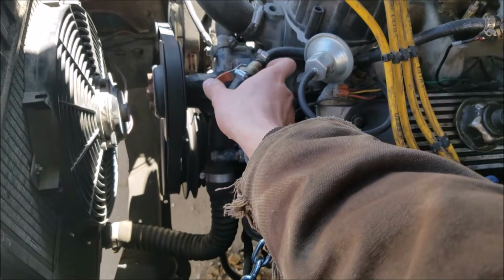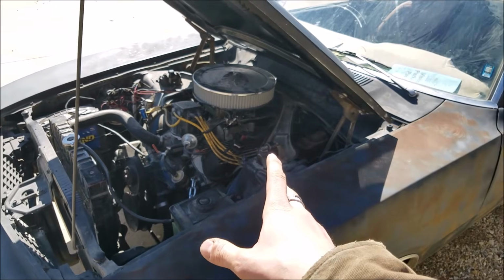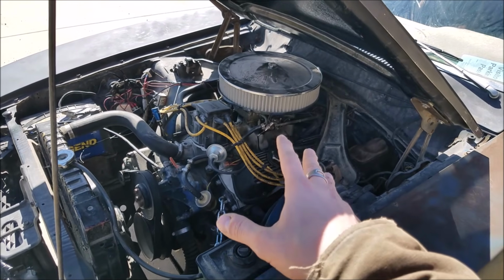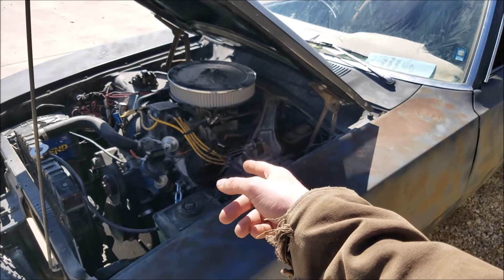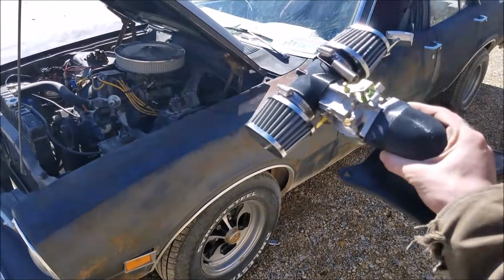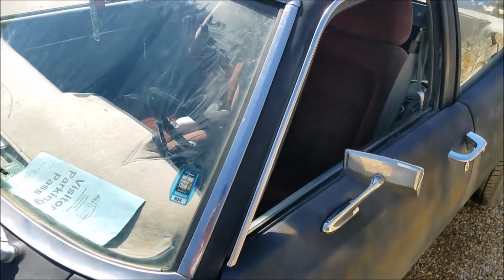What a minty unit. I have this handy dandy ball valve in here because this is the engine in the car I use to test out rebuilds on other folks' carbs when I get done, oftentimes, just to make sure that everything's clean and working the way it should. So with that closed, the engine's going to run and just run the fuel out of the bowls. Then we're not dealing with a bunch of stuff when we're trying to put this guy on. There she goes. All right, we're going to leave that valve closed.